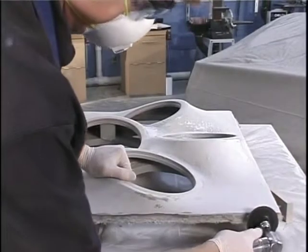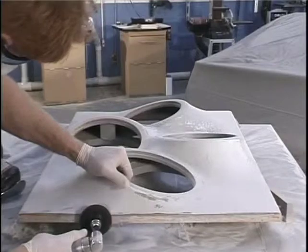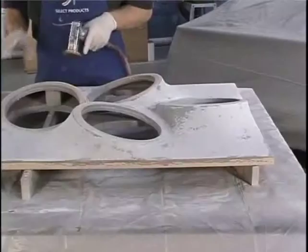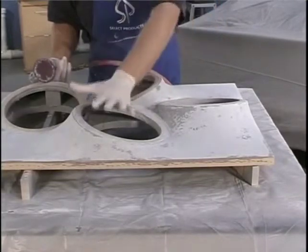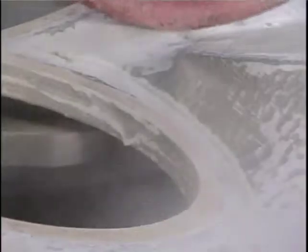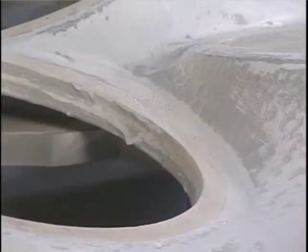All the way back down to the wood, nice and flat. You want to make sure you sand all the way down to the wood on the rings, because that's the only way we know that the speaker is going to fit flat. Any kind of body filler can make that uneven. You're going to see I'm almost finished there, all the way down to the wood - very important. I'm putting pressure this way to get as much of that as I can.